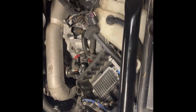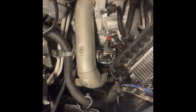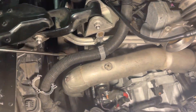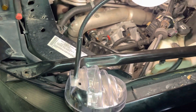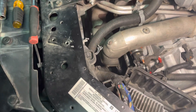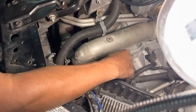The starter has two bolts on the side — trying to figure out the size now. It's two 15mm bolts that you're gonna take out on the left side of the starter. Normally get a magnet to grab them.